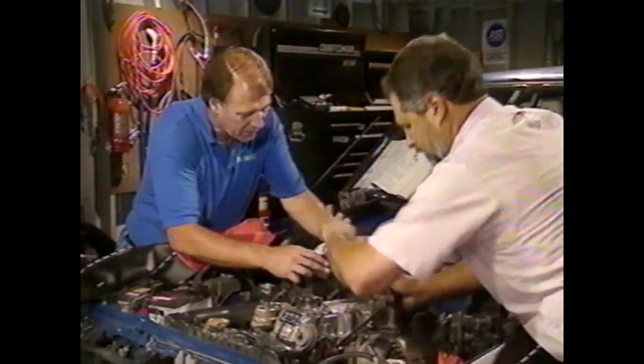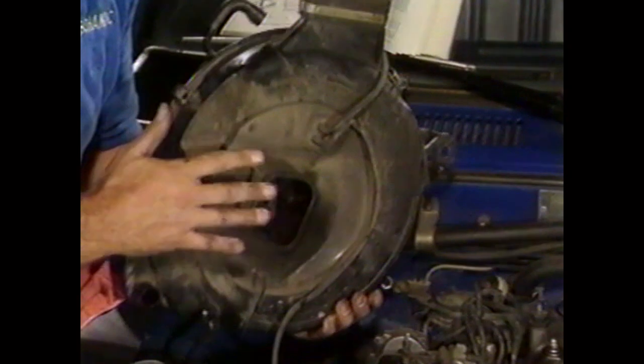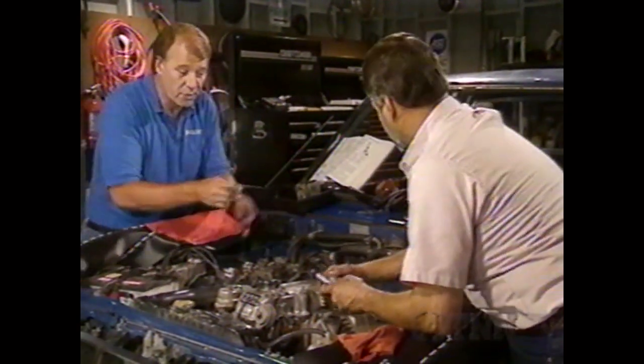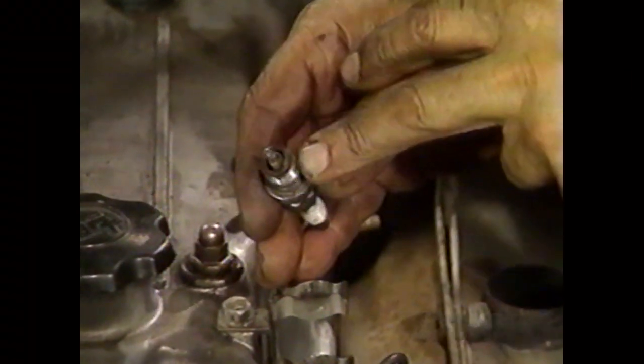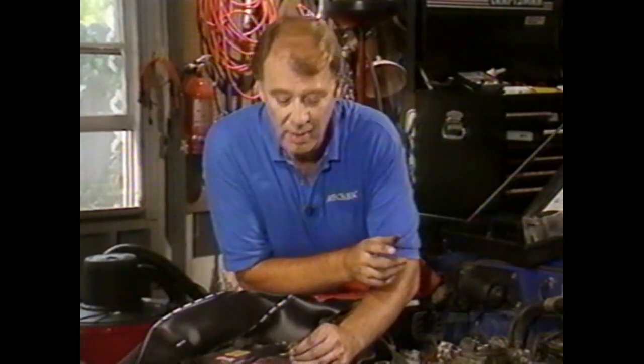Welcome back to Shade Tree Mechanic. We've got the hood off the Toyota to make it easier to see what we're doing and work on the engine. We've also removed the air cleaner, which fits right here on the carburetor. On the bottom side you can see there are plenty of hoses and lines — make sure you mark them so you can put them back in the right spot. Also a good idea to have a service manual handy. I've removed the distributor cap and spark plug wires since we're going to remove all the spark plugs. The number one spark plug has deposits all over it — oil ash deposits — that's a sure sign it's burning a certain amount of oil. You can't tell a lot about an engine by looking at just one spark plug; you need to pull them all out and lay them together.